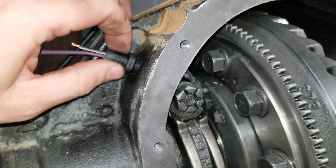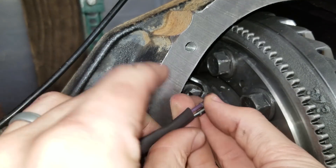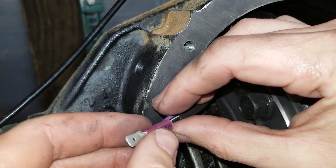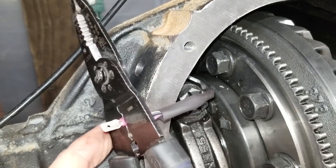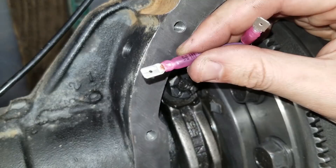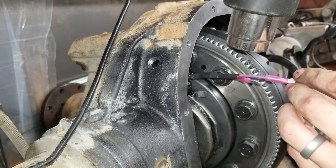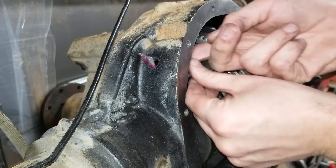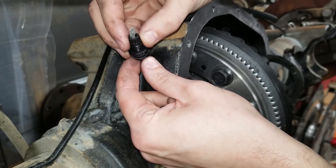With our connections made and our wire lengths figured out, we can pull those wires back through and get some heat shrink on them to keep them protected inside of the differential. I'm choosing to use male spade terminals for my connection on the outside of the differential, mainly because they actually fit through that cable gland. That means if I ever have to remove the locker, these will just fit back through and I can pull the locker out like normal. I also made sure to stagger the lengths so the two spade terminals are not right up next to each other, which makes it a lot easier to pull them through the cable gland.